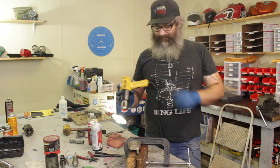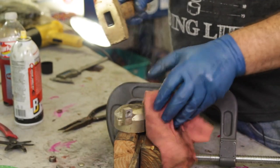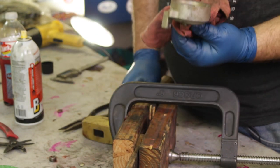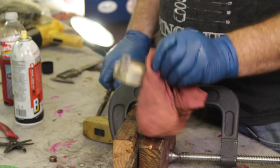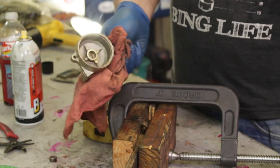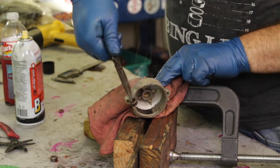You really want to get this second bushing much hotter — we heated it for about 20 minutes with the heat gun. Once heated you can try tapping on the back with a soft hammer to knock it out. We found it easiest to hit it a few times against a soft piece of wood. This housing is very thin and can be easily broken and cracked, so be really careful and make sure you take the time to get this one nice and hot. With the right amount of time it really should fall right out.